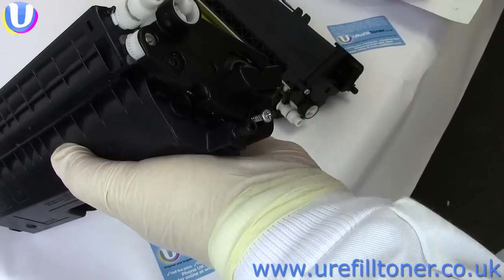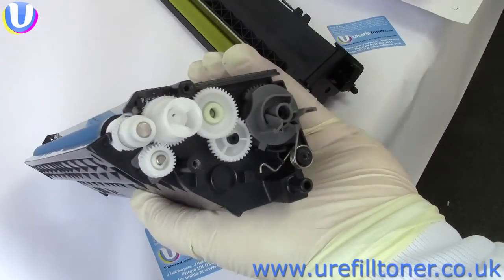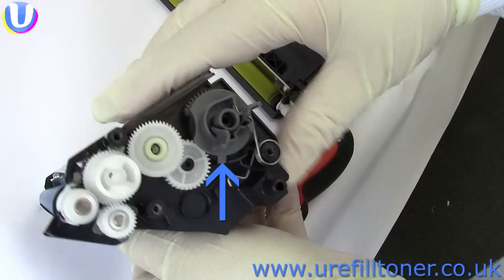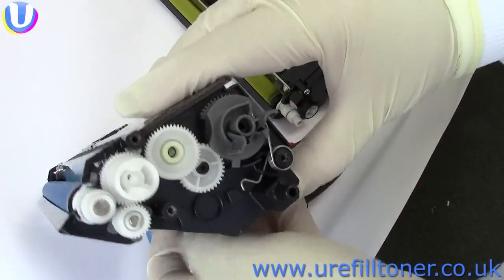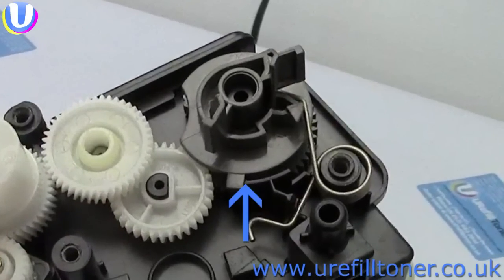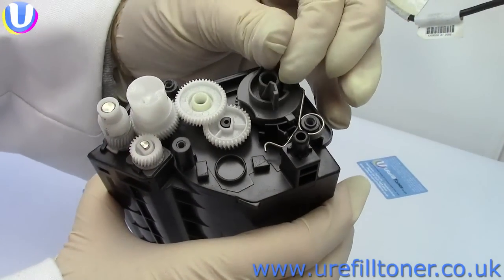Whip out those 3 screws, take the end plate off, and I want you to notice this square notch butted up against a plastic structure right here. So now just lift that reset wheel just a millimetre or so and turn it back to the other side of that plastic structure and put it down again, with the square notch on the other side of the plastic